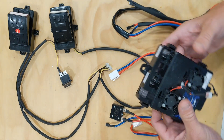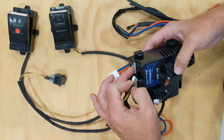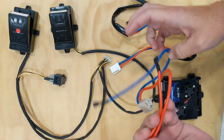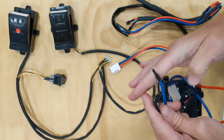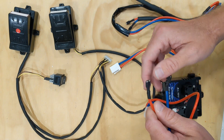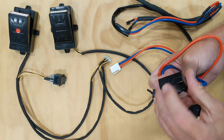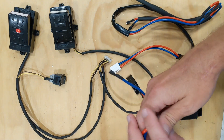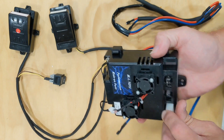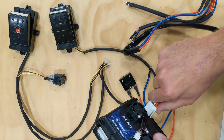Once that's mounted, we can start plugging things in. The pedals and forward/reverse switch will plug in here — you can only plug things in in one spot, so you can't get it wrong. The battery lead cord you'll run up through the firewall. We purposely leave the connector off so you can easily run the cords through the firewall without a bulky connector. If you have the Power Wheels style connector, red to white and blue to black. This is a self-resetting breaker, so it can also go up under the firewall out of the way.